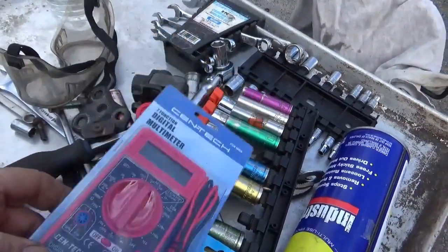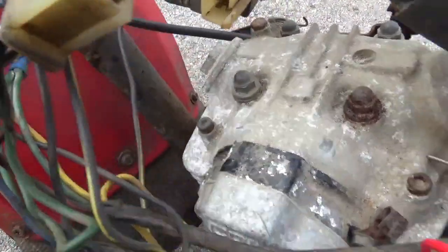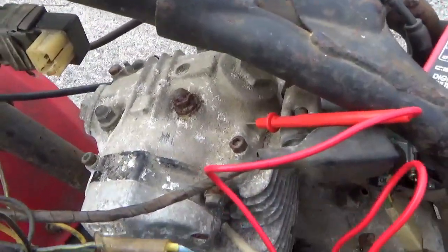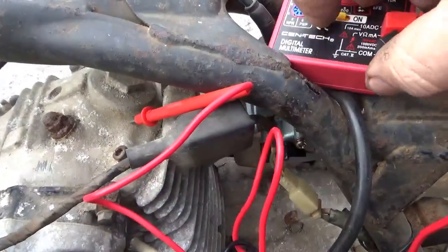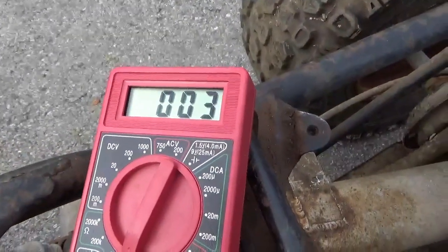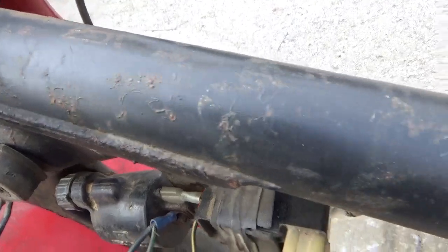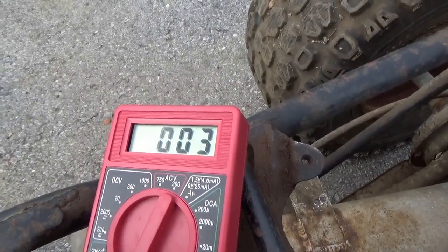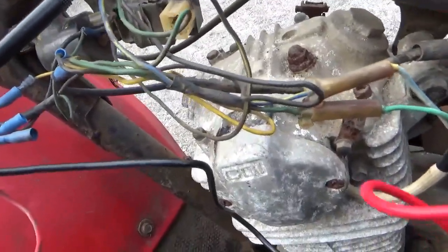If you own an ATV, try to come up with ten dollars to own a meter. So we're unplugged. You can see that green wire — that probe is jammed in there, meaning one of the probes is hooked to what this thing sees as ground. Ground in the real world should be your engine and your frame. Turn on the meter and check: is my engine grounded? We get down to about two ohms — that's about as good as you're going to get. Is my frame grounded? We're down to three ohms through the paint. So the CDI is seeing ground.